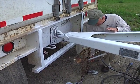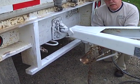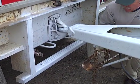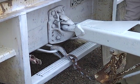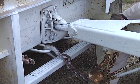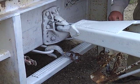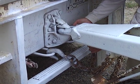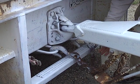The next part of the procedure is we will use our safety chains and hooks. We cross these — it's more bilaterally symmetrical on its pull, and it's actually a safer and more recommended way to do that. You'll notice I'm going over the bumper and then locking that latch in place.